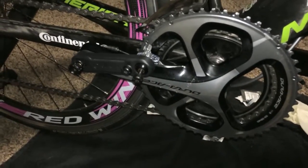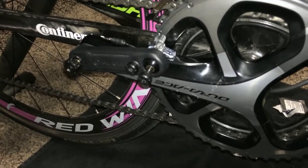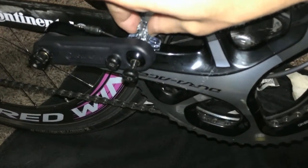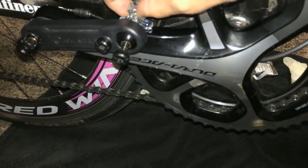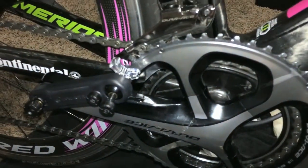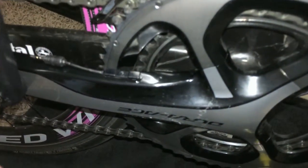My 5 minutes is up for my right side of the crank arm, so I'm just going to lift this guy up right here — be careful, straight up, it should come off. They do recommend making sure that this is in the small chain ring, just so you don't have to worry about hitting the derailleur or anything like that.